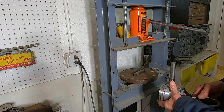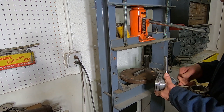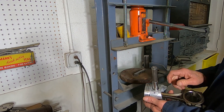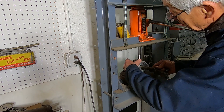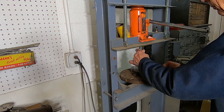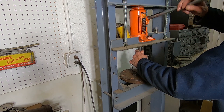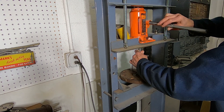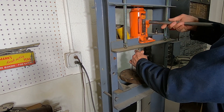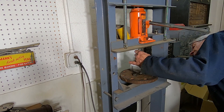I've got this little thing I made to fit right in there. This is what I used to press the other ones out, because I had to go down through the piston to get them pressed out. This little block here will rest right across the flat part of the piston. I'm going to put a little pressure down and make sure everything's centered.